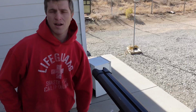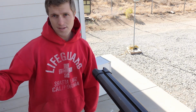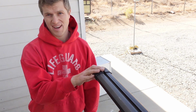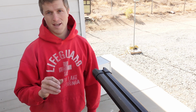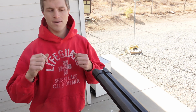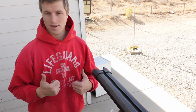Okay, nice. All right guys, now that we got our rear two quick releases soft set, I'm gonna go ahead and soft set the ones on the front, repeat the process. So I'm gonna start by taking this end cap on, slide the right, slide the left, softly set it at 34 5/8. Then I'm gonna put the rooftop tent on, cinch it down, and make sure that I'm nice and centered, take it off, clamp it, I'll tighten it all the way, and should be good to go.